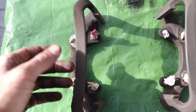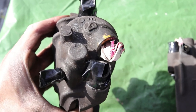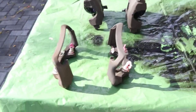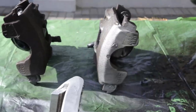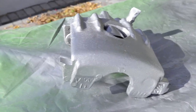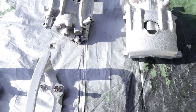I got it all cleaned up using a wire brush and some brake cleaner. I've got tape covering all the areas I don't want spray to go over, and newspaper covering the bolt holes so no spray gets in there. I'm going to use the silver and give it a couple of coats, and once that's dry I'll use a clear coat as well. You mainly want to get the face covered because that's what you see. I left it in the sun for about an hour after the second coat and it came out quite nice. Now I'm just going to give it a clear coat, and once that's dry I can fit it.